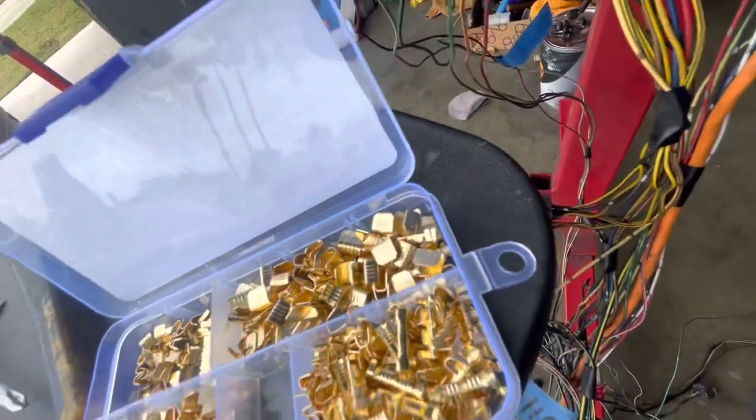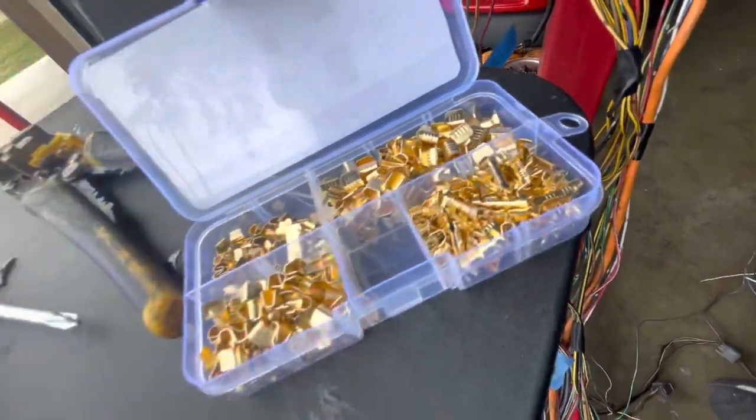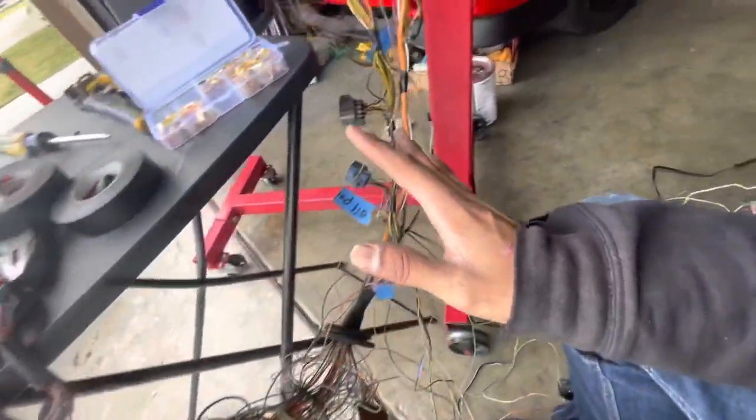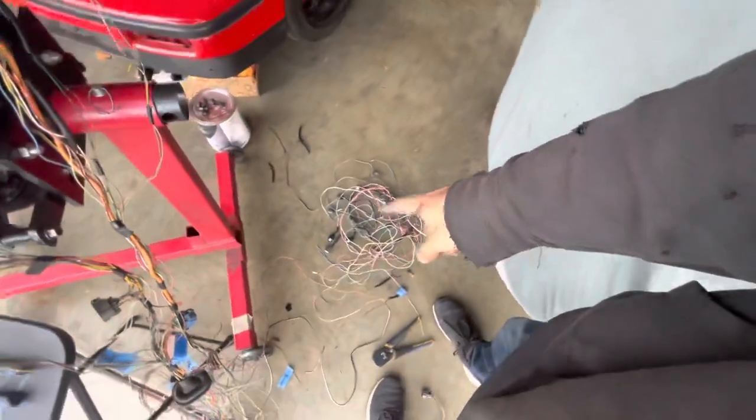Drew found me this crimp set off Amazon along with a crimping tool — pretty affordable, not the Harbor Freight set. These are actual crimps. If we're doing any shortening or extending of wires, like the oil pressure wire that needs extending, we're doing crimps. Think about it: solder is applied with heat, and in an engine you have a lot of heat and vibration — you could potentially soften those solders enough to separate. A crimp is a physical mechanical pinch of the wire — it's holding those wires together at all times.